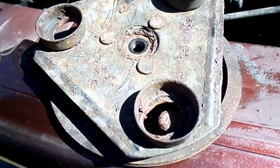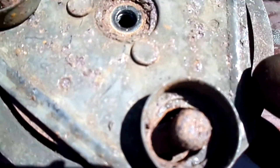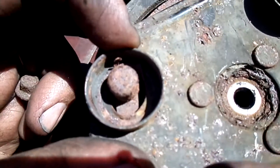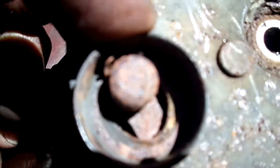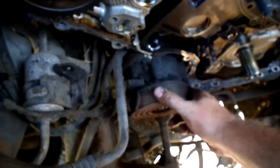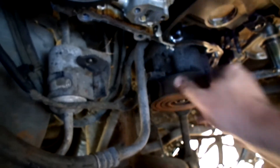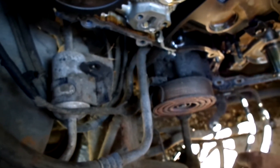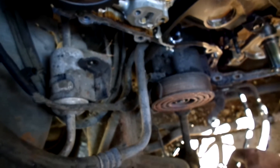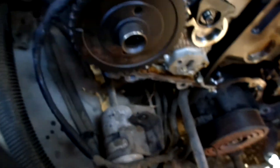I took off the clutch hub on the AC compressor. They must have had the air conditioning on for the whole 200,000 miles because not only are all the dampeners gone — look at the holes, totally oblonged — it hasn't had dampeners in a very long time. There's no bearing down there anymore. It was a coastal town so I'd assume they actually had the defrost on all the time — you wouldn't need the AC over there that often — but they seriously wore this out. Thanks for watching so far, I'll keep you guys posted.